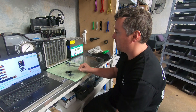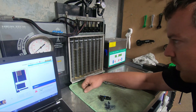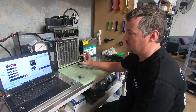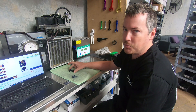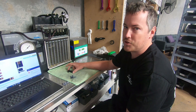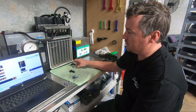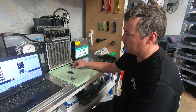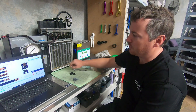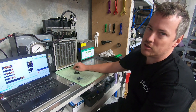We've got a difference of around five percent. For people who are going to panic about our off-the-shelf ones: ninety percent of the time it's never going to be a problem — five percent is not going to blow your engine up unless your tune is right at the limit. Any decent tuner won't be tuning in those conditions. But if you have an engine where one cylinder gets more air from the intake manifold and you put the lowest-flowing injector on that cylinder, you could have a ten percent difference between fuel and air in a cylinder, which can be borderline unhappy.